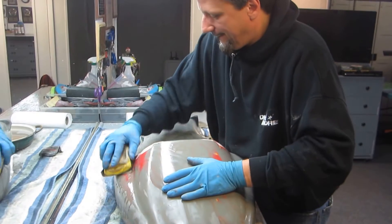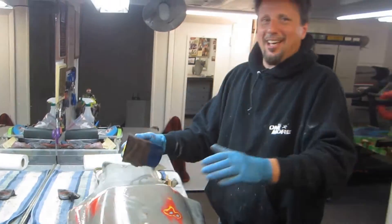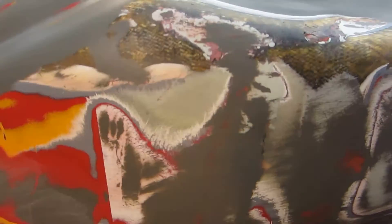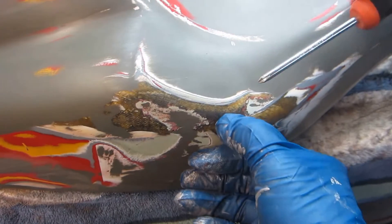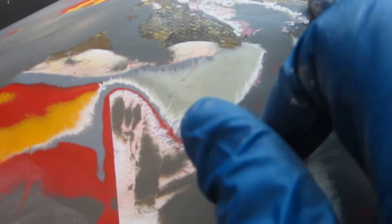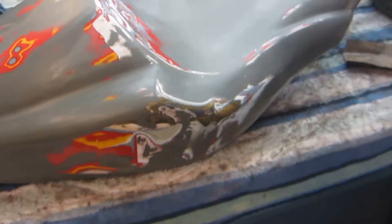Are you ready for me to do this little repair? What happened is there's a piece of bondo that was in here from the job before — I don't know if you can see it, right there — that has popped out. The first thing you've got to do is get a hairdryer and dry this, because there'll be moisture that seeped inside. Dry this whole area on the fiber. I'll get the CA, then you sand it dry, because you don't want any water wicking in there.